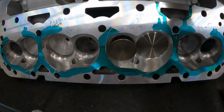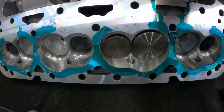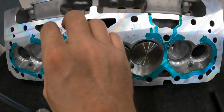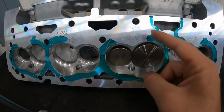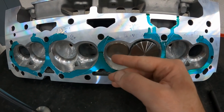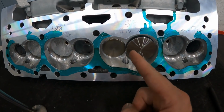So at this time, usually when the valves get about here, this is called overlap, we open the intake valve because there's a low pressure created here, because the exhaust pressure is out that way, high pressure creating a low pressure here because there's less gas there. And that low pressure will cause the air to be pulled from the intake valve first. And then we close the exhaust valve and the piston starts drawing more. That's how your beginning part starts.